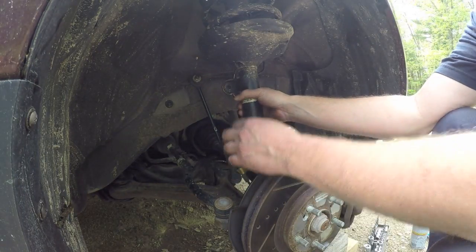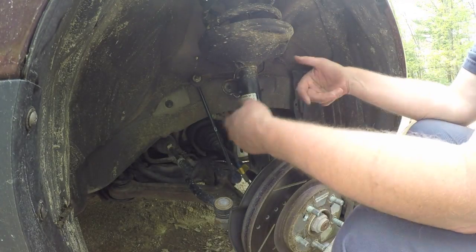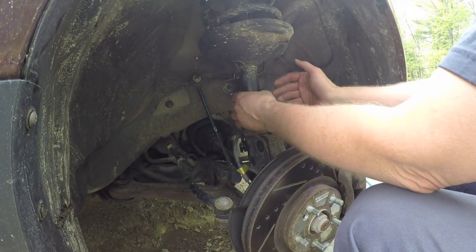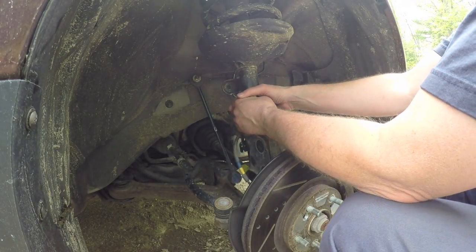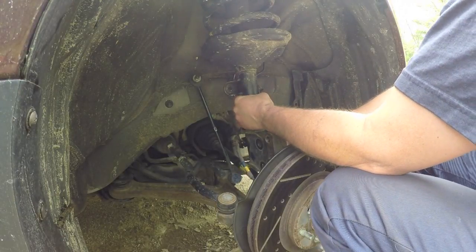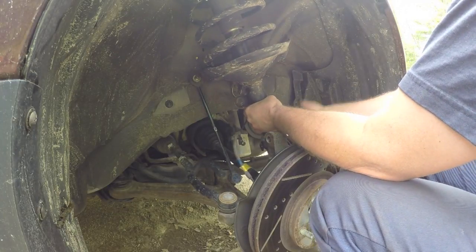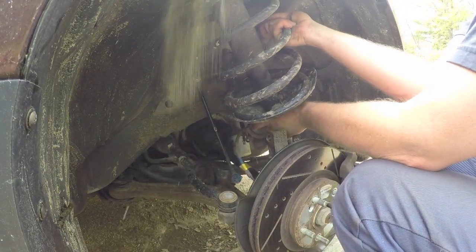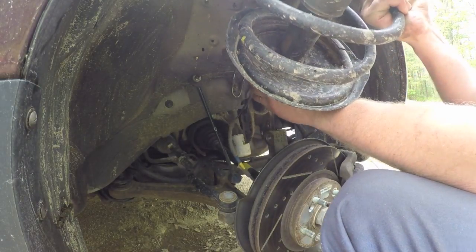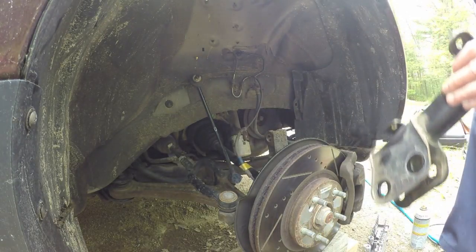What I just did off camera was remove those 13 millimeter nuts that I had loosened earlier — they're completely removed and kind of fall off into that cowling area. I'm not going to worry about them right now because we'll pop up that shield on the top when we go to reinstall. I push this off so it disengages from the knuckle, shift it to the right, being very careful of the cables, the brake line, and the ABS cable. I drop this whole thing down top-out first, and now I have the whole strut assembly out.